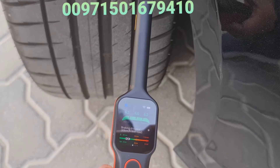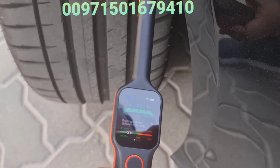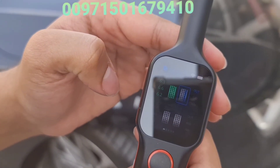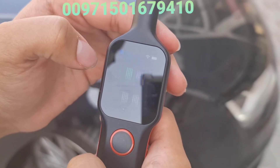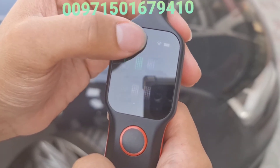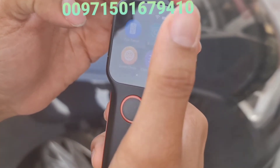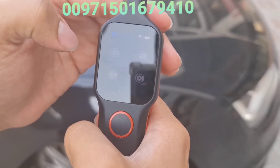You can see three locations measured, and it gives a green color — meaning the tire is uniform and in good condition. This tire is really new and in good status. If it gives you red on one of the sides, that means the tire is more worn or has had more pressure on that side. Now I'm going to do the brake disc test.